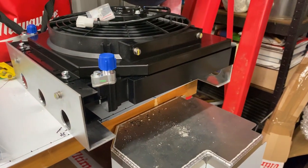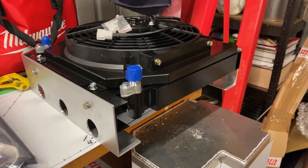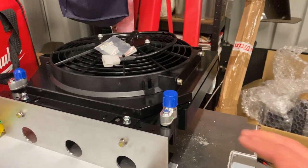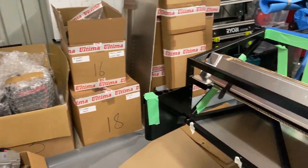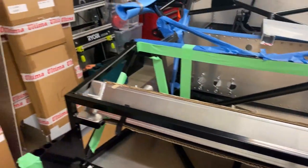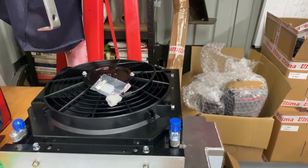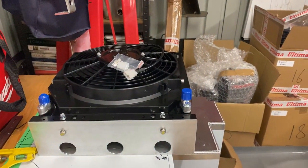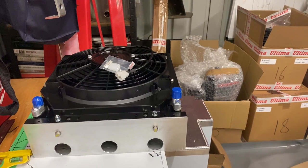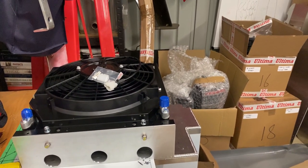This is the beauty of diverging from the factory recommended installations — I think it'll be a good thing in the end, but it means there's going to be some R&D and fabrication of brackets. This is a 350 by 350 condenser, whereas the radiator is 300 tall, so we'll have to work out how to make that fit. We also need to get the condenser refrigerant pipework in and out. I'll show you the disassembly process, and then we'll see whether we can fit this in — otherwise worst case is I need to look for another place for the condenser or get a specially made one produced.